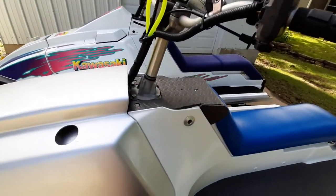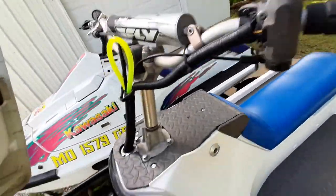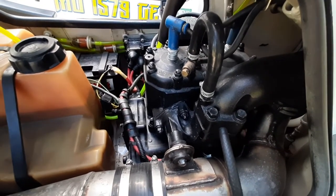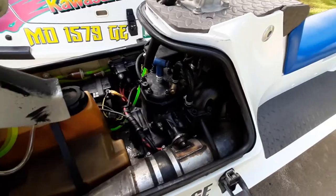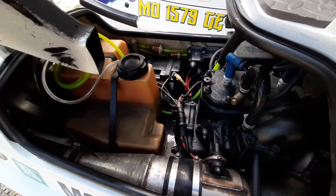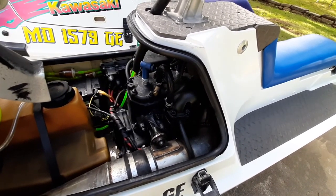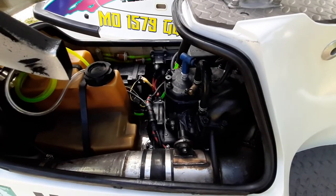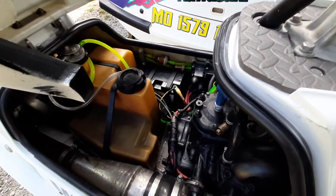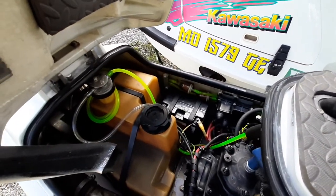So a couple of years ago we took the motors apart — both motors needed crank bearings. Since these are the factory 650s, we took them completely apart, pressed the cranks apart, and put new ball bearings all the way through. That quieted them right down. Getting the cranks lined back up when pressing them together wasn't too difficult, but it was definitely about the limit of what a 12-ton press will do. Both came out well within the two-thousandths runout spec.